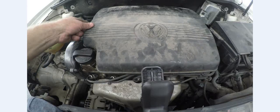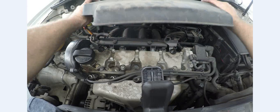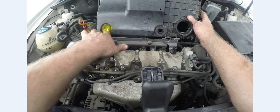So with this Polo, what we need to do is just take the air filter box off. On either side there are no screws or nuts that hold onto it. There is a breather pipe at the back — just pop that breather pipe off. Take left hand and right hand and basically pull up. You will find that it just pops off because you have these lugs here. When you turn the filter around, you will notice it has grommets which fit into those lugs — two at the back and two in the front. That's basically how you take your airbox off. Very easy, very simple.